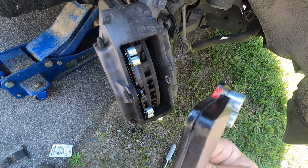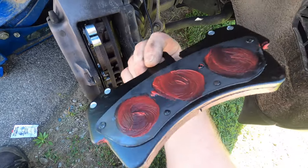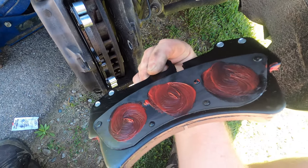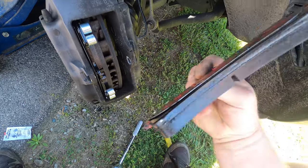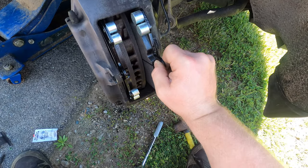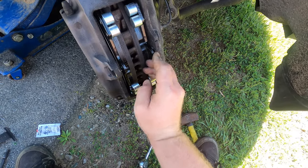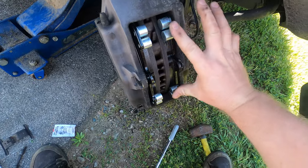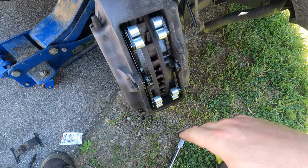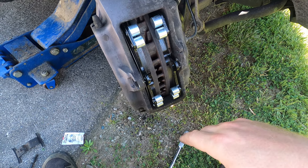You can see a little tiny bit of grease — tiny bit. I did a little smear per contact point. Even this on the back doesn't really need that much; I went a little heavy on it. Just be careful that you're not smearing it onto your rotor when you put it together. Put it in there — down — and that's it, that's all it takes. We'll do the other side, get our spring and pins and all that stuff back in place and we'll be good to go.